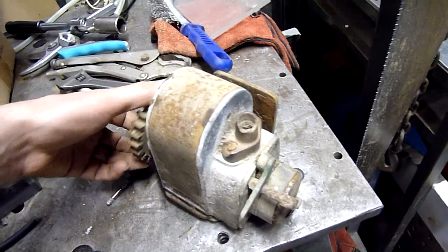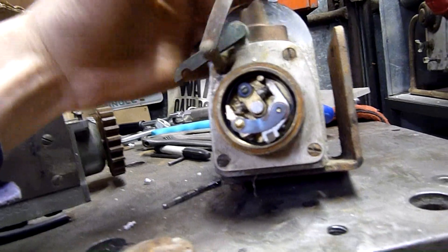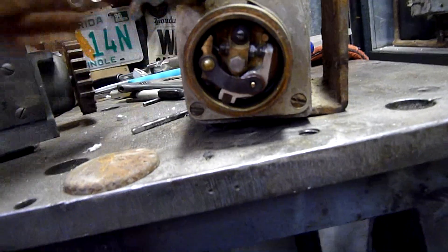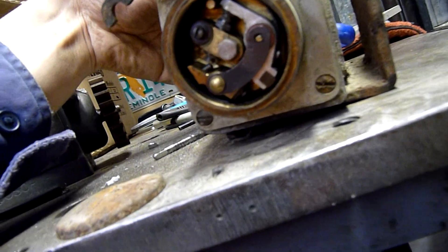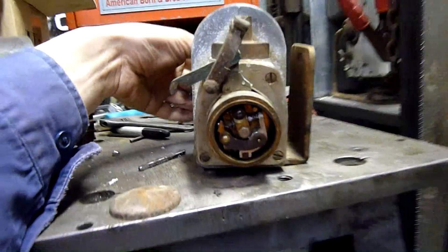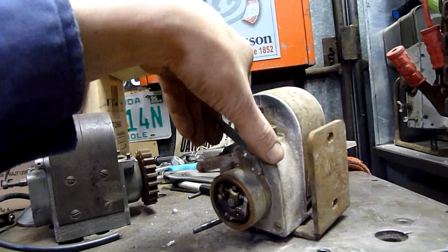This one here turns — it's a little bit rough. I'm going to open it up properly. The points housing is completely clean, which is a good sign; it hasn't been drowned. These ones have points that rotate. See that little screw there has come off the little jacking post — I wonder if that's a problem. It's interesting that it's there on an angle; it might not be an issue. And that's the advance and retard.